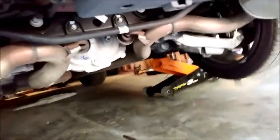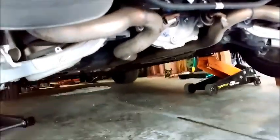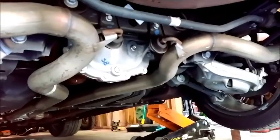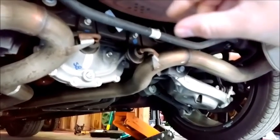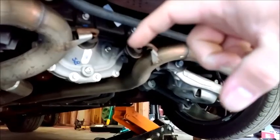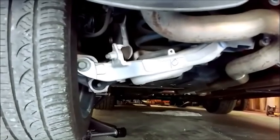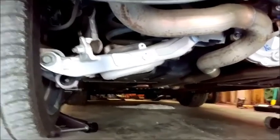But anyways, today we're working on the Mustang. We're putting in, I've asked him twice now what this thing's called. What's it called? The BMR Cradle Lockout Kit for the Mustang GTs. I think all the Mustangs could use it, but basically what we're doing is down here on the rear subframe, this kit goes in, and it's going to bolt in. We're adding little spacers to the top, and these cute little track arms to the subframe, and this basically is going to take all the wheel hop out of this. Like 80% of the wheel hop will be eliminated, making a much more aggressive, fun, fast car.